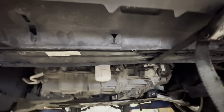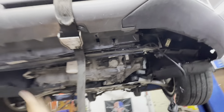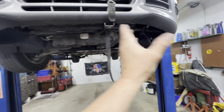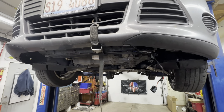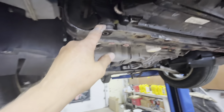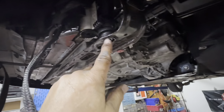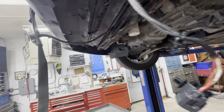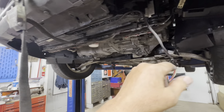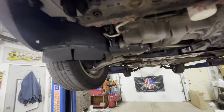My radiator assembly is in — I got the top bushings in and tightened up my strap. Now I can put the core support brace up in there. Get one side started with at least a couple of threads. The oblong bushing for the radiator — the oblong part faces the front. Now everything is matched up. Undo the strap, fish it out from underneath. Put the other two bolts in, slowly tighten them up, and guide your bushings into the support. Then do your lower radiator hose.